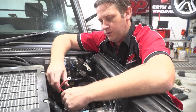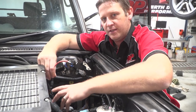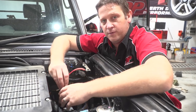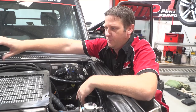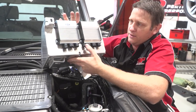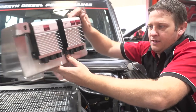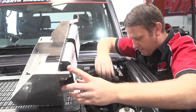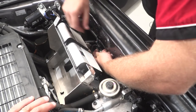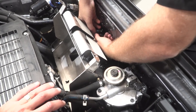Previously we dragged the twin core wire through into the cab for the momentary start switch. We've got this loom here and we'll push it to the side and connect it up to the SBI solenoid once the tray is in situ. With the injector drivers, we have a three connector and a four connector - make sure when the car sits and the tray goes back in that the looms are connected to the correct drivers. If you need to swap them, they will swap over on the tray to get it to fit the way you've got the loom sitting.